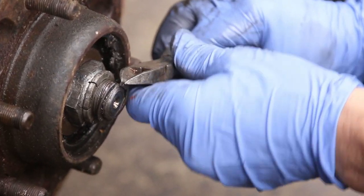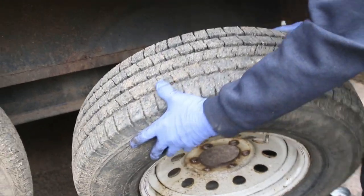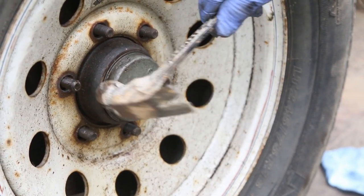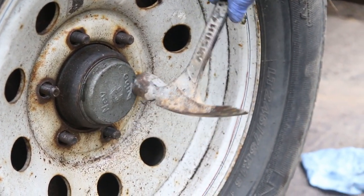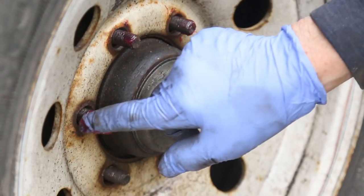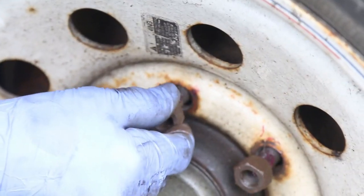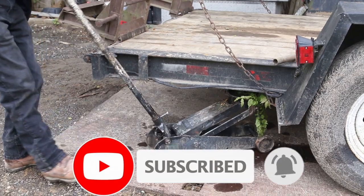There is a safety washer that goes on the outer part — make sure you put it in there. Now all you have to do is put on the tire, tie up all the loose ends, torque all the bolts properly, and put that middle cap in. I also like to grease the screws just a little bit because it makes them easier to remove later for maintenance. This is very important — get the right amount of torque per your trailer's torque setting. And voila, we're done! Thanks for watching, see you in the next video.